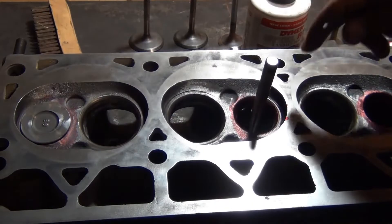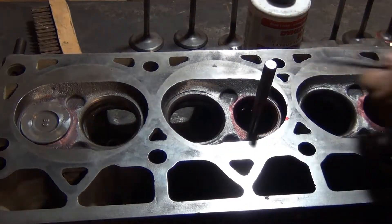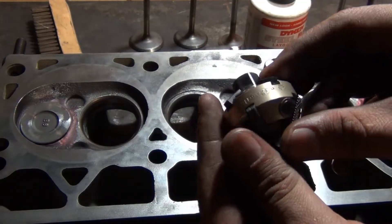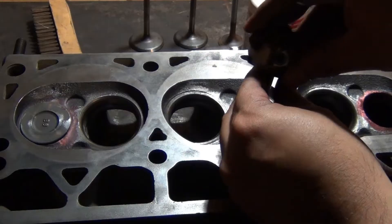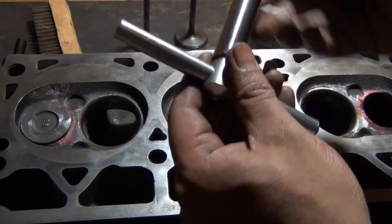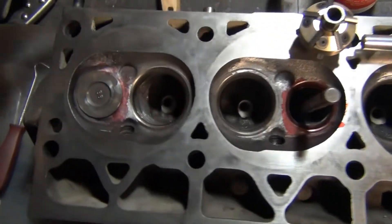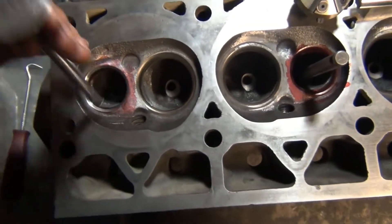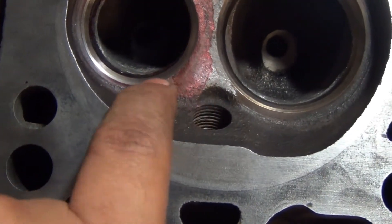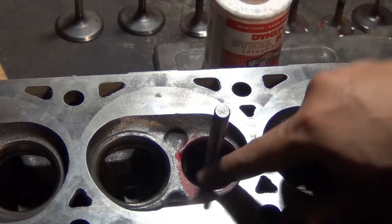To set it up you simply install the pilot onto the guide until it's locked — there's a little handle here to make sure you push it in far enough. Once it's tight, you need to make sure that you're using the 45 degree side where the arrow is pointing, and that goes right there. Then grab your handle and the extension and you're basically ready to start. The reason I added the Dykem is so I can see as I'm cutting to make sure the seat is completely flat. I'll add a little bit of WD-40 all around.